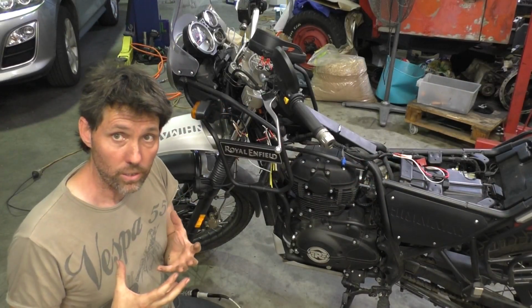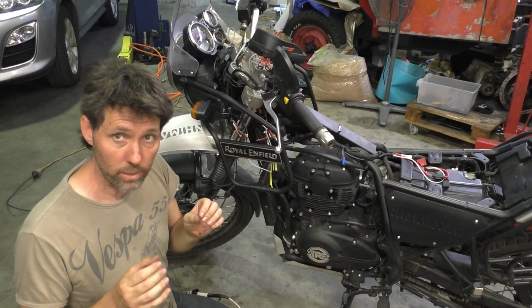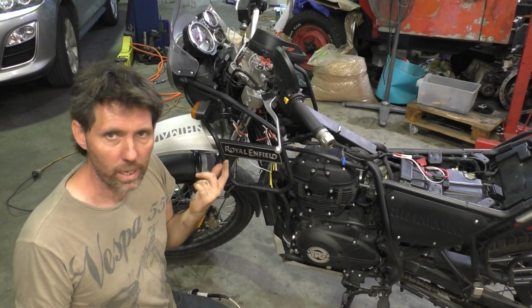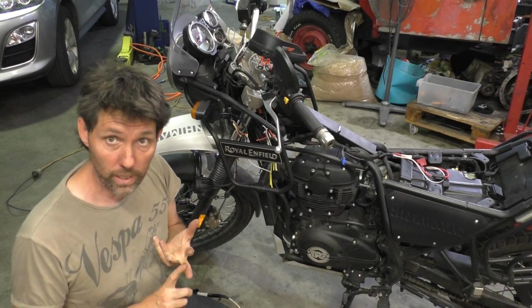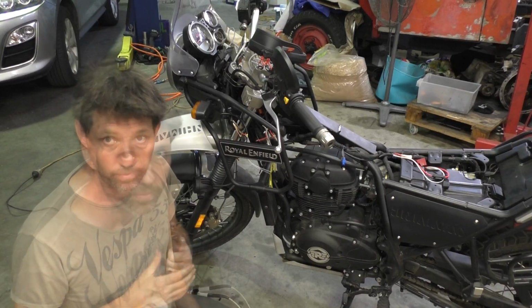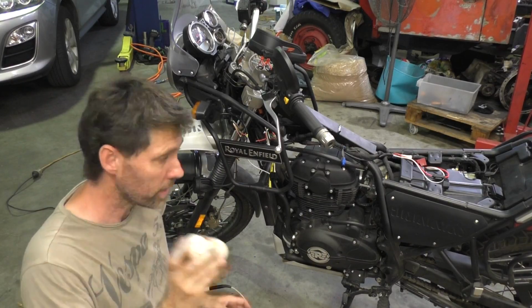When you've got a lot of wires to join like that, another way you can go about it is putting a ring terminal on each one, then put a bolt through it. But I find this way it's easier to solder it so you get a good connection, and then also easier to heat shrink the whole thing to keep it insulated. Once again, more liquid electrical tape.